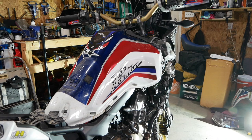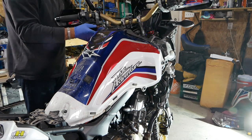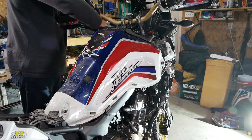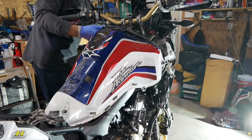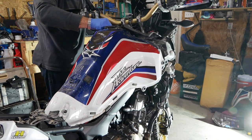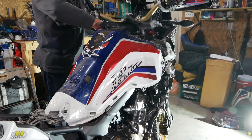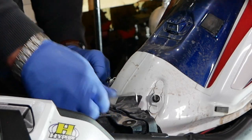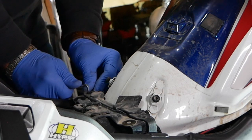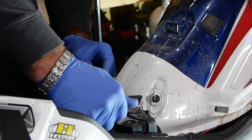So now the bike is naked — all the side panels are removed. To remove the tank, you're going to take this plastic piece off here — it's just sitting on clips at this point because we took the screws out. Just gently wiggle it and it will come out. Now to remove the tank there are another two push pins holding the plastic piece that's holding the latch mechanism.